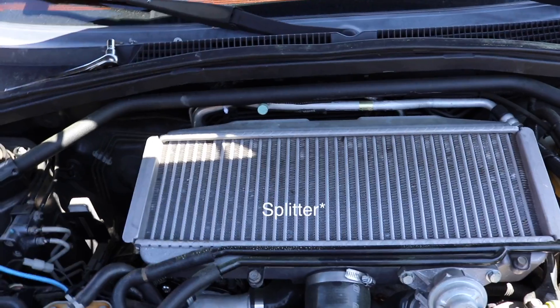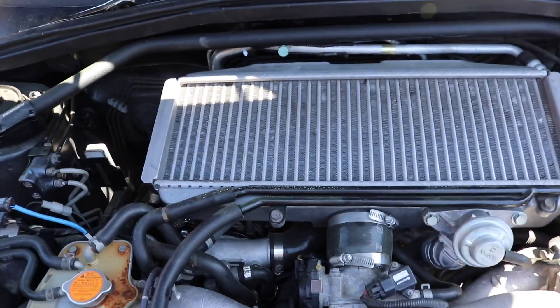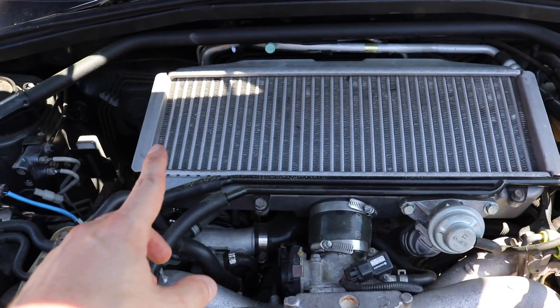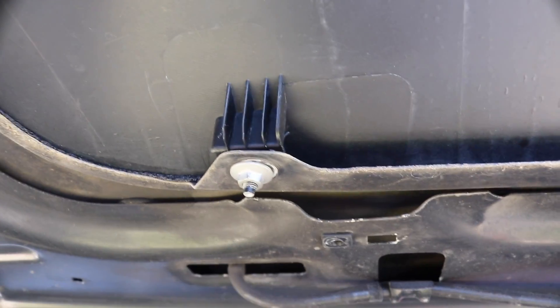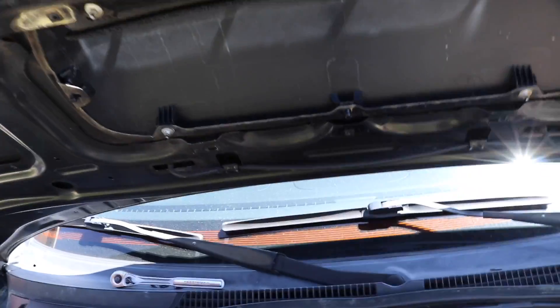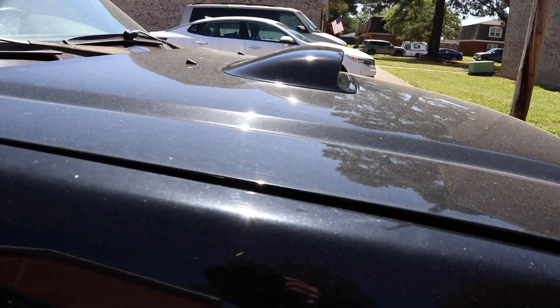So go through and tighten up all those, then we can put our Process West intercooler splitter on — which is not meant for this intercooler. If you have an aftermarket intercooler like a GrimmSpeed or a Process West it'll fit perfectly. However, this is bigger than all of those because it came off a brand new STI. I honestly don't know how it's going to fit. I've got them all snugged on — these aren't something you're supposed to really tighten hard because of the plastic. It's definitely not something you want to torque down because you're going to snap that plastic. Everything looks sitting flush — look at that, it's a big boy scoop right there.